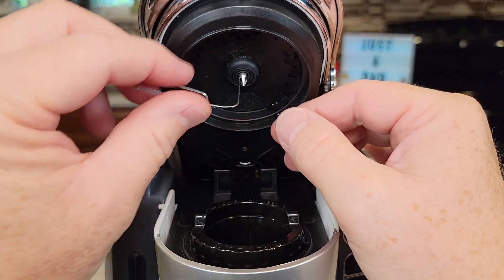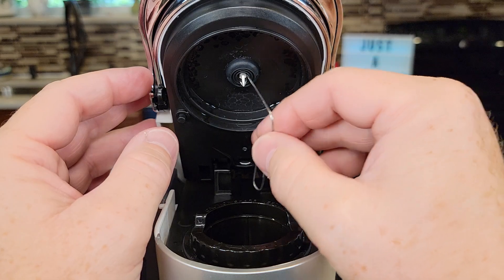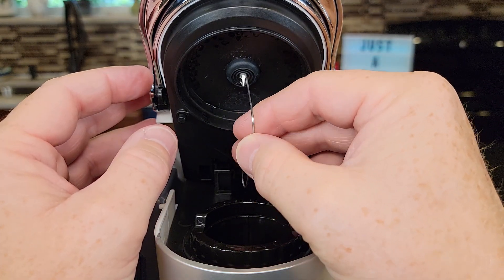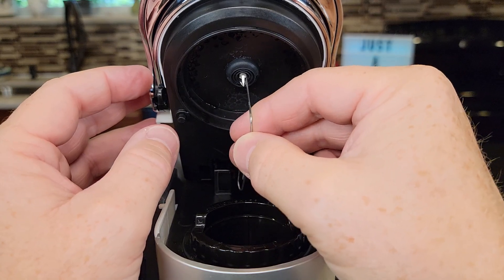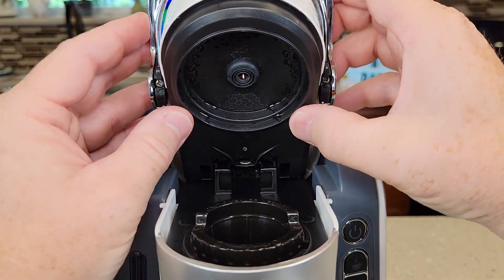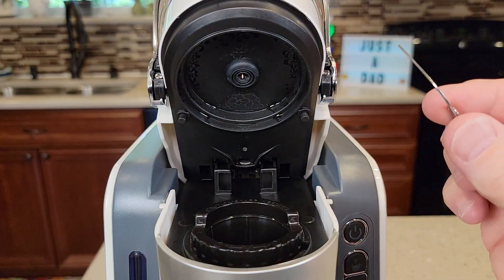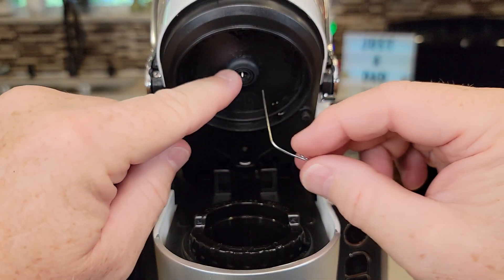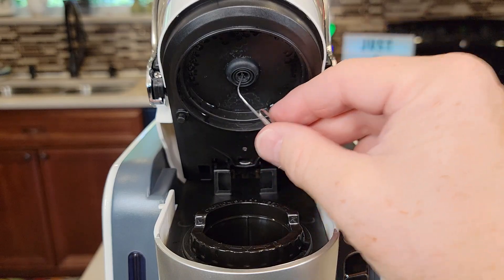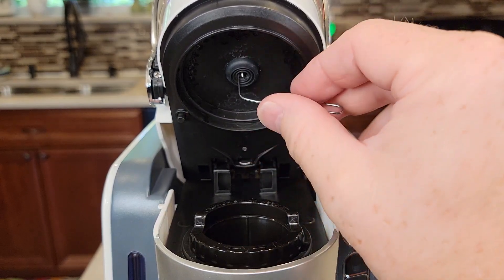Be careful, don't force this. You may have to do this several times. On some coffee makers I have had to clean this about three or four times until eventually some water came out. Now we're going to lift the handle and the needle goes back — you can practice this a couple of times, that might also clean it up. You may even have to leave the needle retracted and kind of go up in it a little bit to get a little more room in there — just clean it up, try to find both sides, do the same thing, rotate it.